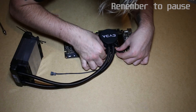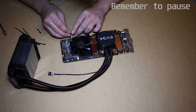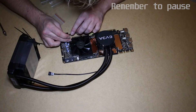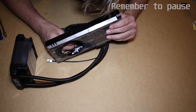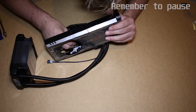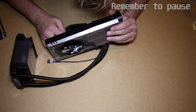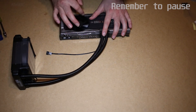Run the cable for the card fan and pump around the pump and under the groove of the heatsink. You can use the provided super tiny tape to hold the cable in place if need be. Attach the LED cable on the new shroud to the card and then wiggle the shroud down and into place. Now is a good time to check nothing is obstructing the fan — you don't want to figure that out later.